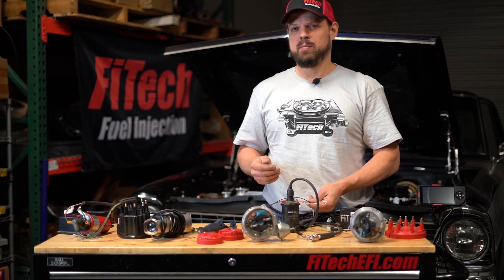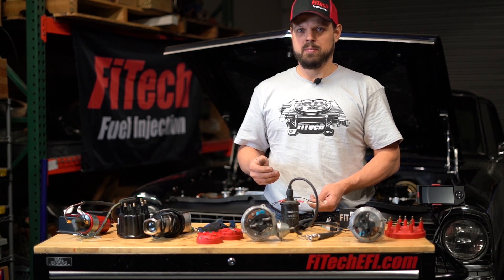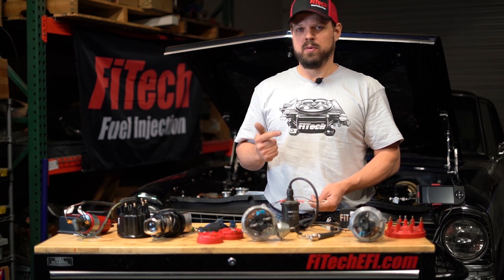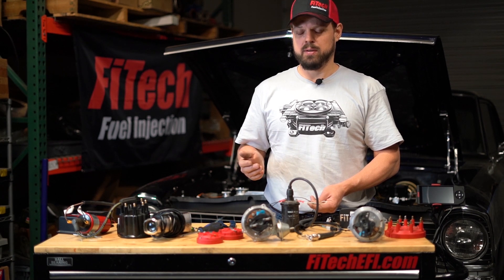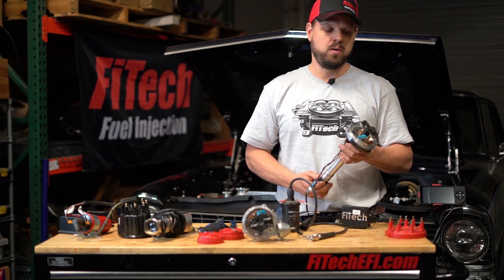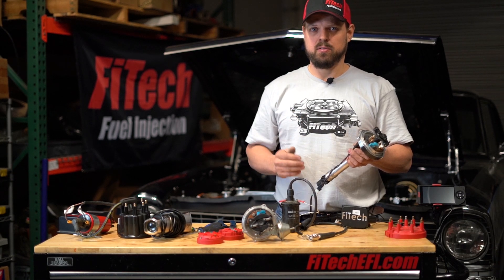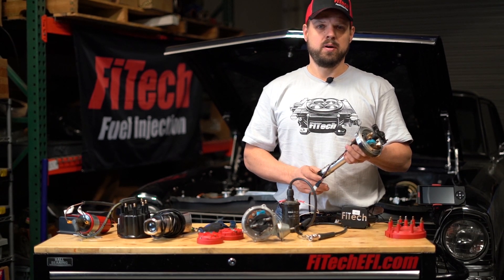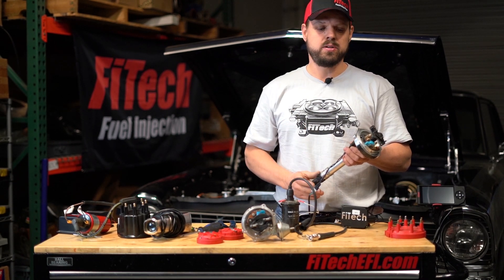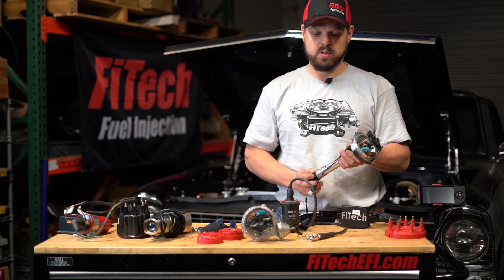The purpose of ignition timing control is to deliver the spark to a cylinder at the right time. If the spark is not delivered at the right time, side effects could include ignition knock or very poor efficiency; if it's completely at the wrong time, it won't ignite at all. At cranking speeds, the coil begins to dwell when the tooth passes the pickup and then fires a few degrees afterwards. At cranking, we also do a multiple spark — after the first spark there's a short delay and then a second spark is generated.